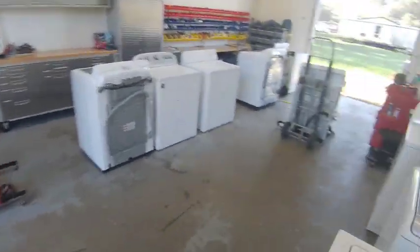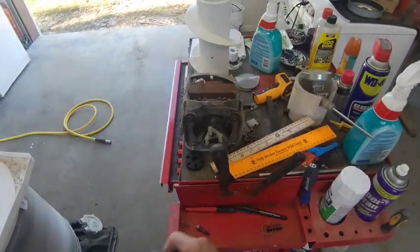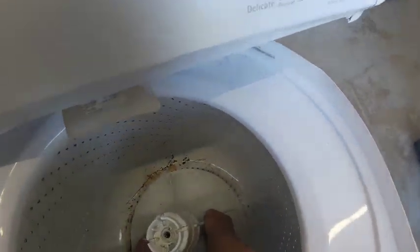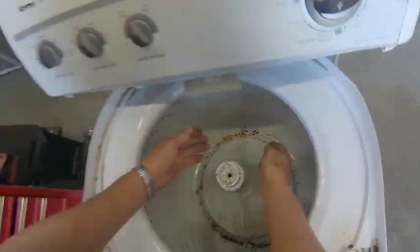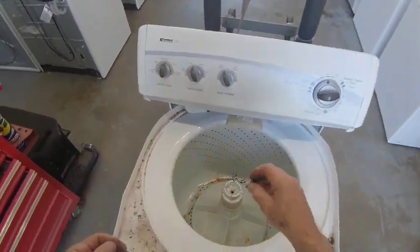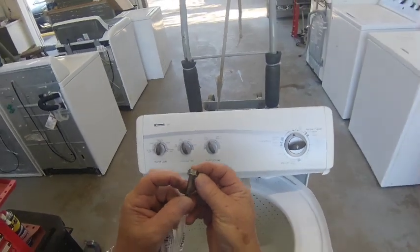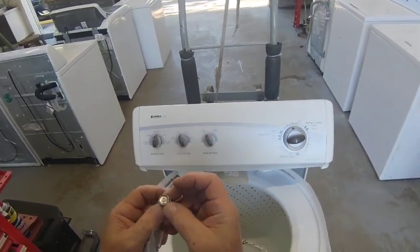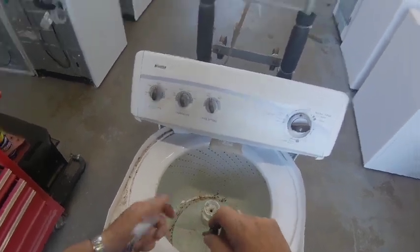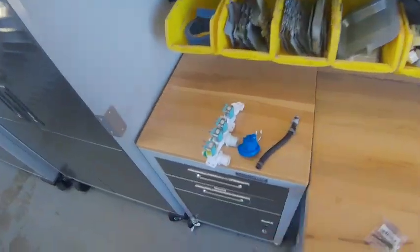So anyway, I think I always preface stuff with 'so anyway.' I have this agitator and it's stuck on here — stuck really well. In the past, what I've done is I've taken a bolt and run it down in there, left it out about that much. And I'll take an air hammer, pick up on the agitator with an air hammer, and that would come off. But the air hammer wants to just wander all over this.